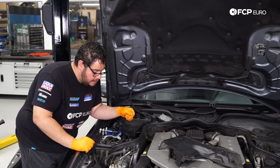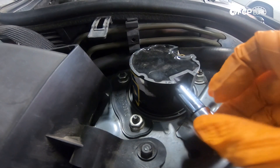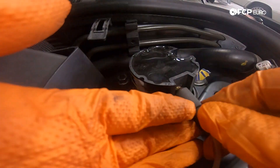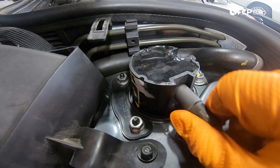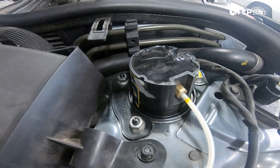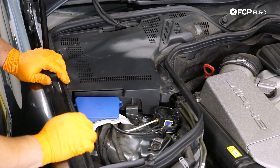With our new air strut installed, there's usually a white protective fitting covering the brass piece — remove that with a 10 millimeter socket. Now reconnect the airline: get the fitting into place and tighten with fingers using the tool, or very gently with a wrench — the torque value is about 2 Newton meters. Then plug in the electrical connector. Finally, reinstall the cowl piece, lifting the weatherstrip as needed to seat it back in place properly.